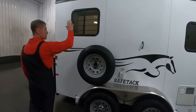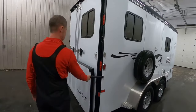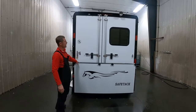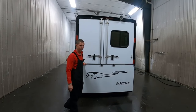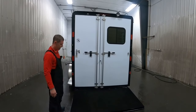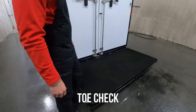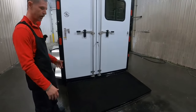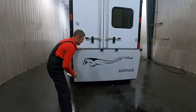A couple of windows — one for the horse, one for the kitchen area up front. Let's take a look at the horse area. I did go ahead and add a ramp to this one. I like ramps — we see less skinned legs and knees on ramp loads versus step-up. And if we just drop that, you can actually lift it with your toes. I always do what we call the toe check on ramps to make sure they're easy to operate and don't require a lot of effort.